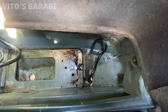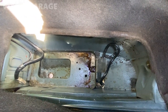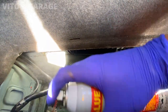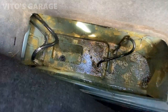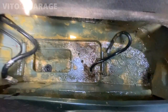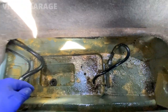The battery area has some oil because I used to put engine oil on there so it doesn't rust out. Now I have Fluid Film so I'm gonna Fluid Film this area before installing the battery. The area is fully Fluid Filmed - everything is protected and greased up. I cleaned up and reinstalled that drain plug, so everything is ready to put the battery back in.